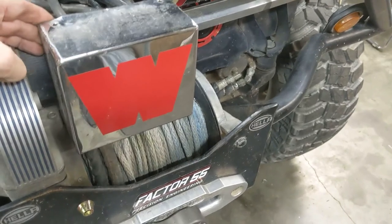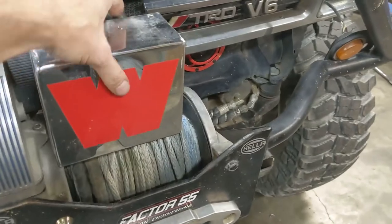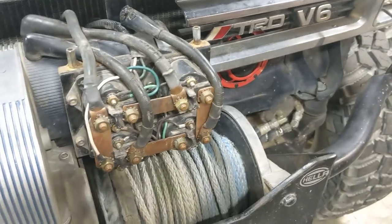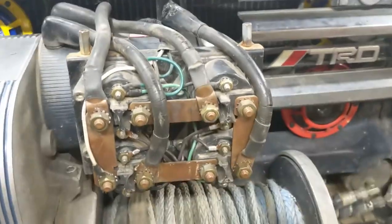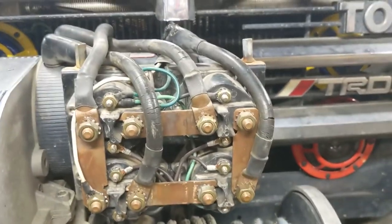All that's going to stay and we're just going to fit it all up underneath this cover that's already existing. This is just a custom plate that I built to cover the new solenoid plate. This is like an 80s style winch. It has the fine spline motor as opposed to the keyed. These are a later style or an aftermarket solenoid setup. They work fine, but there are a little bit of corrosion points.